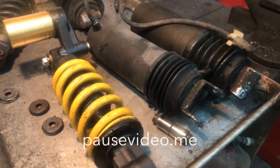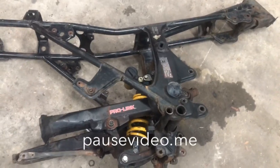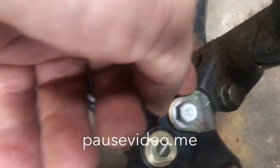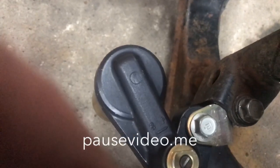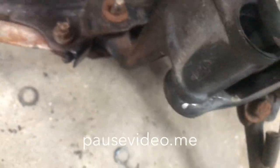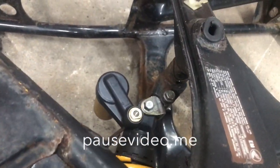I'm back — I got it installed on the GL 500 frame. You can see how the top piece attaches just like that. You might want to, but you only have to tack weld it onto the existing frame piece here. I find if you tighten these bolts up enough, it ain't going nowhere. This is how it attaches on the bottom, just like the original shock did, using the clevis off of the GL 500. For the spacing on the shock, you'll need to put a couple of washers on each side and then you should be good to go.